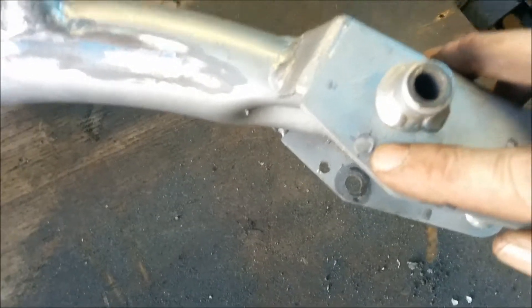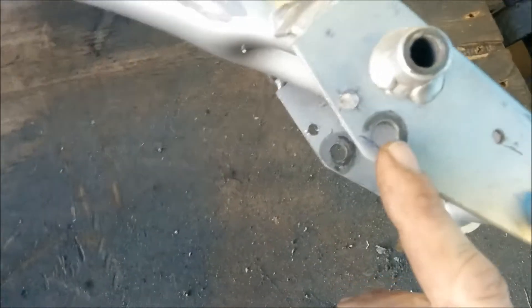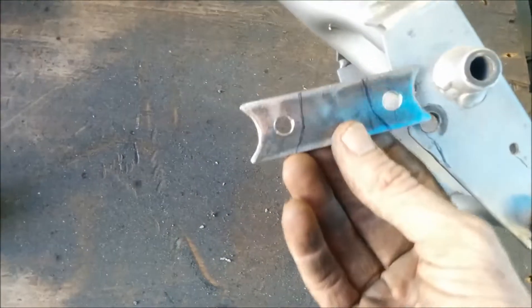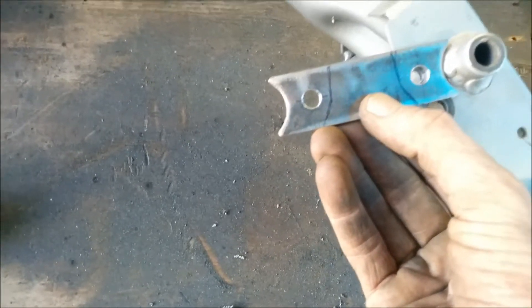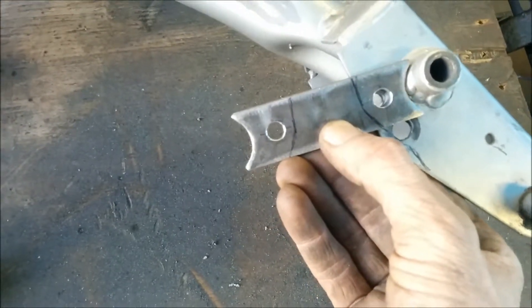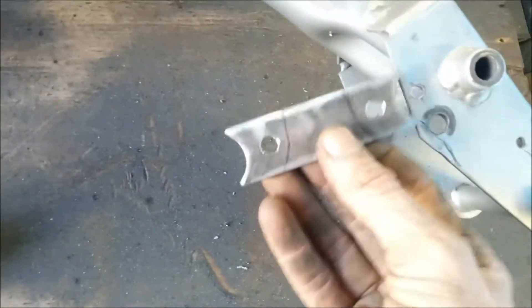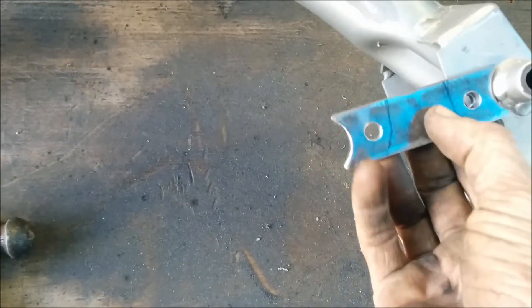You can see where I drilled the new hole here, but obviously it's not big enough - it needs to be 5/16s, and there ain't no meat there to put a motor mount in. So what I've done here is come up with this idea. This is two brackets. You can just weld her down each side and then weld it on the back too. And when I weld it on the back here, that's going to make this double the thickness.